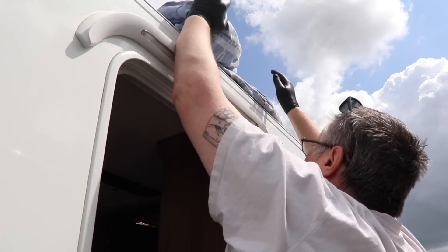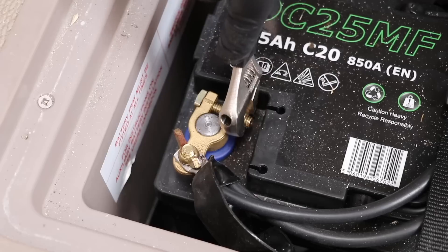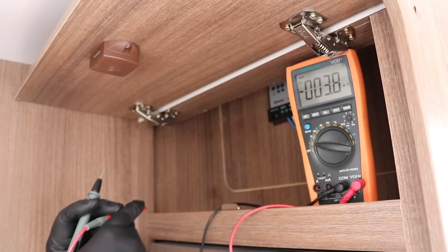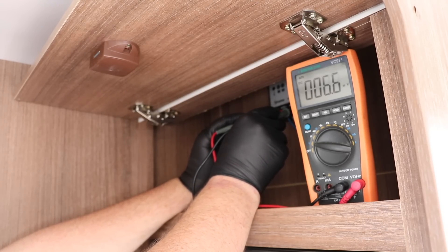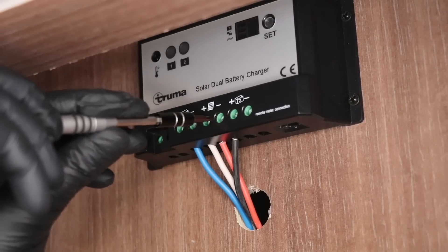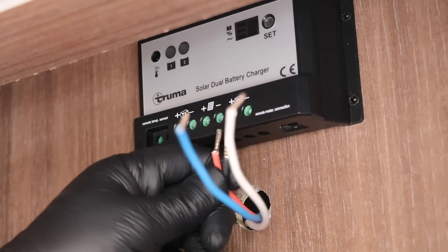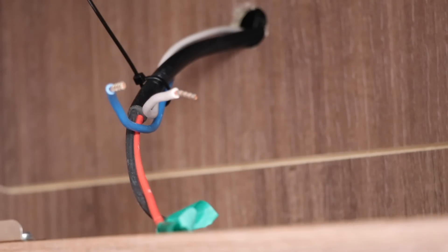Firstly, to stop the panel from sending any voltage on this lovely sunny day, I'm simply going to cover it with the dog's bed to stop it producing power. Before I disconnect the battery, I'm setting my tracker and alarm into service mode so I don't get any power-down notifications from my tracking company. I disconnect the negative terminal first, just like a car, then the positive — and that's it, I've completely isolated the 12 volt system. I'm measuring the terminals to confirm there's no power left — just very small traces. I remove the two wires for the battery, noting the colours: blue is positive, white is negative. The panel wires are red and black. I then remove the two wires for the panel, covering one cable with tape to prevent residual power, and adding a cable tie to stop them disappearing down the back of the cupboard.